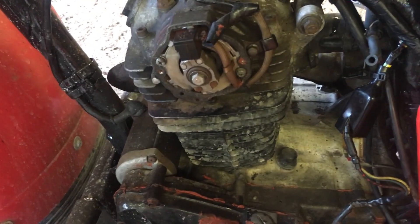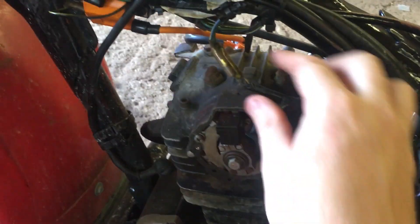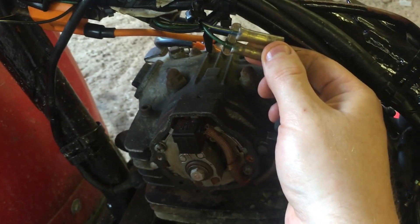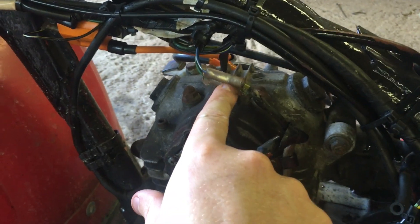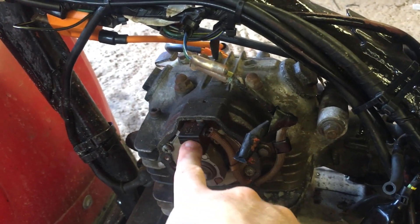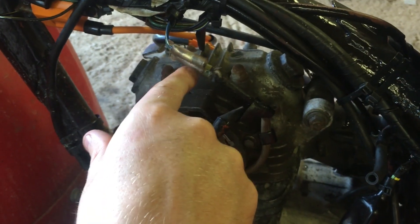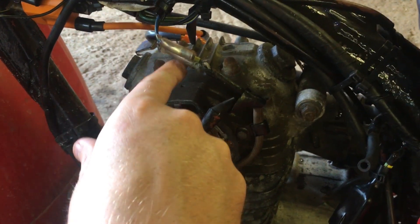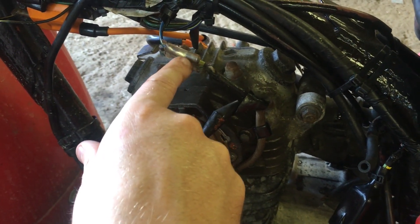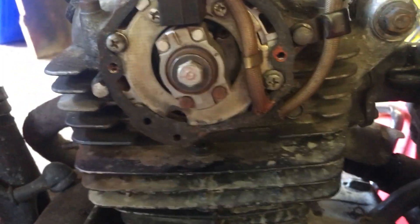To test this it's pretty simple — it literally has two wires, a ground and a blue and yellow wire. If you want to test for resistance of the sensor, you'd unplug these two connectors, stick your multimeter on, and read the resistance across both of them. It should be about 30 ohms roughly. If you're getting that, then that's a good sensor.